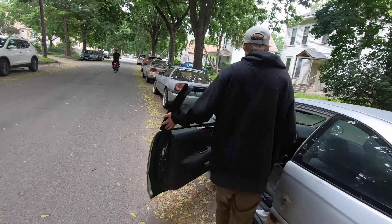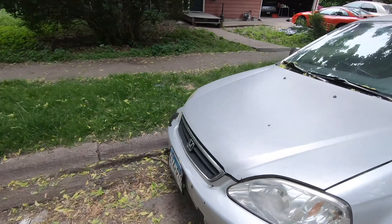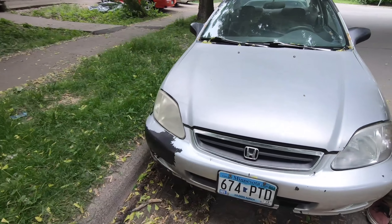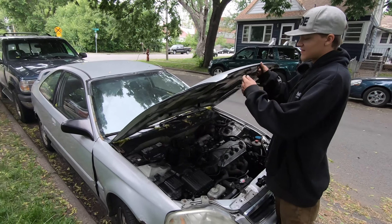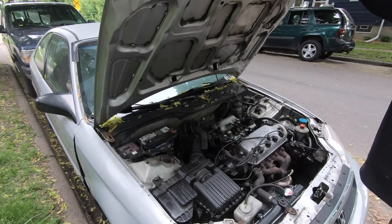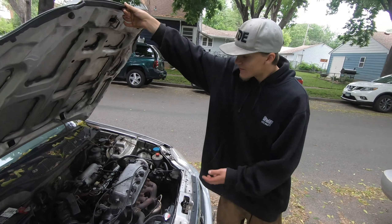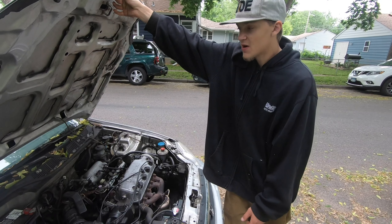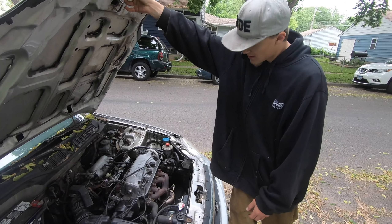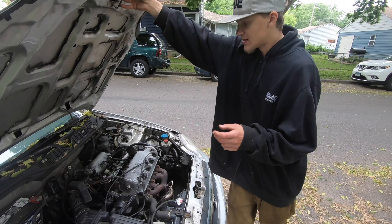We can get our other Mark 3. We did pretty much get it assembled on the last video, but I haven't worked out some of the kinks. There's a system security alarm thing that makes it so I don't have spark or fuel. I was messing around with the relays and all of a sudden I got fuel again, but I'm still not getting spark. I'm assuming it's just a very old distributor that my buddy already messed up a little bit. So probably gonna get a new distributor too.